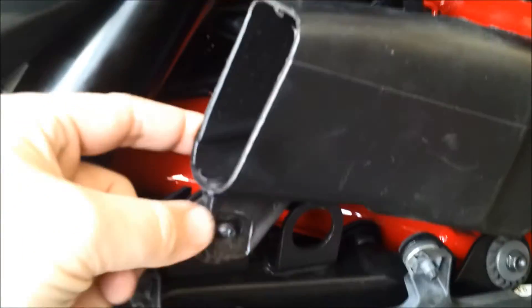This intake tube here is what we're going to be messing with next. It is already loose in the front. It has a nut way in the back — you can barely see it back there — and then another one down low beside it. There's also one deep in the back up high, so there are three of them. Pull those three out and make sure you don't drop them down into the engine bay. There's also a tube right here that connects onto the back — press down on the top of it to pull that off when you're taking it off.